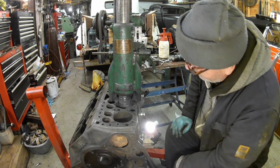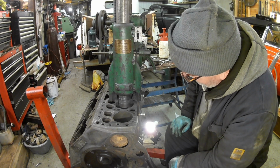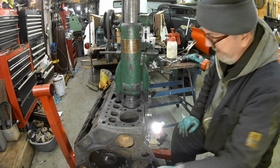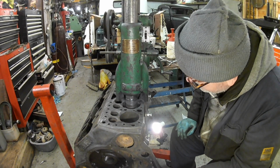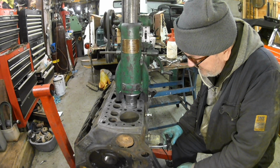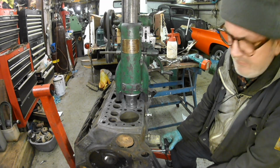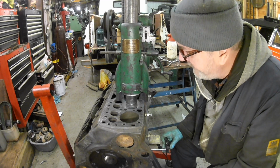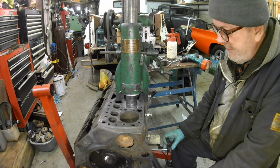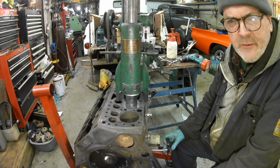Now that's an intermittent cut at the top until there, because it's running across the relief. There's an area part way down the bore. Now I hope when the tool goes fast it goes clean. If it goes worse, it means that's the water jacket, doesn't it?